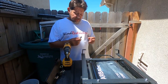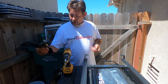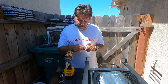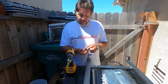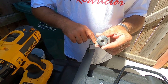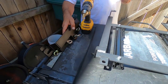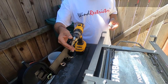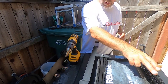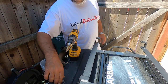So what we're going to have to do is to mount the brackets and mount the harness brackets — we have to use bolt extenders, and these are quite a bit beefier than the size of the bolt that's stock in the car. So we're going to have to widen these holes out on the seat rail as well as on the harness brackets. I've got a step drill set up here, and I should just be able to punch through all four of these holes and the four holes here, and hopefully we should be good.